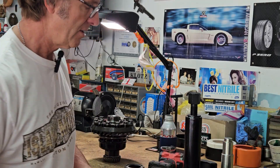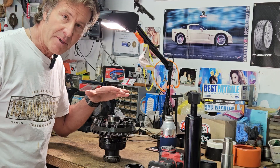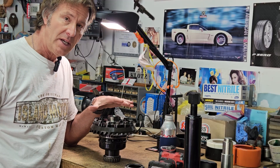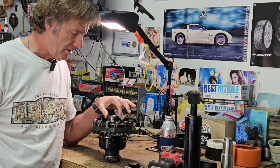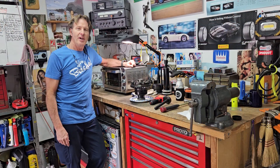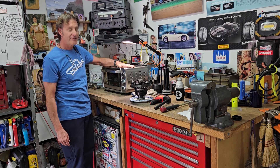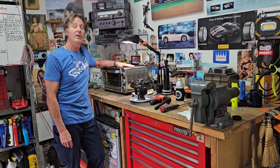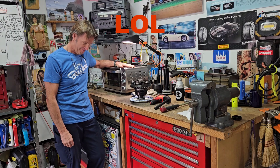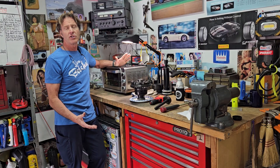Next you're going to see me with the new bearing. I'm going to heat up the new bearing and I'm hoping it goes on with little or minimal force. The new bearing is still coming. So here we are in the garage — cooking with Kurbmeister. I've got the Weis toaster oven, and today we are going to be cooking some really nice tapered roller bearings. I have the toaster oven, I'm going to shoot for 250 degrees.